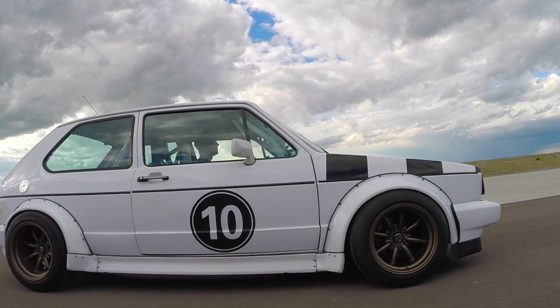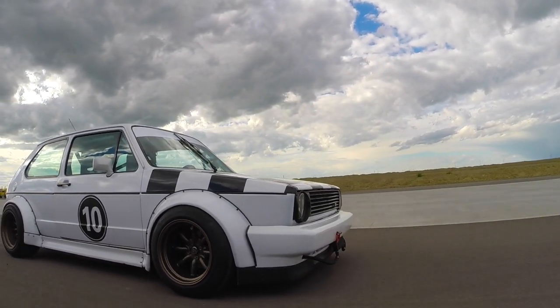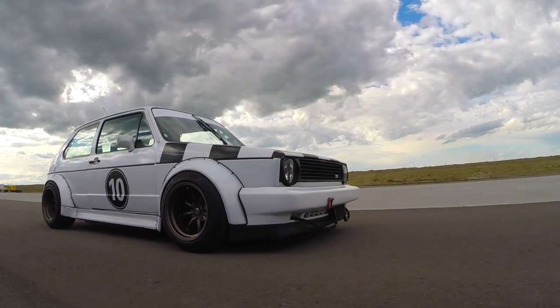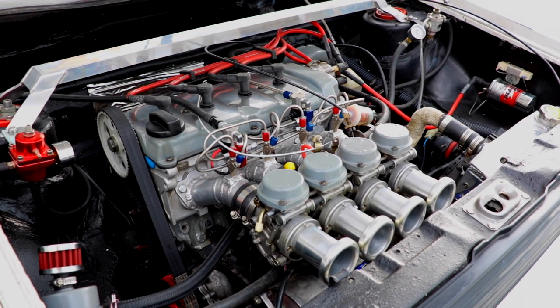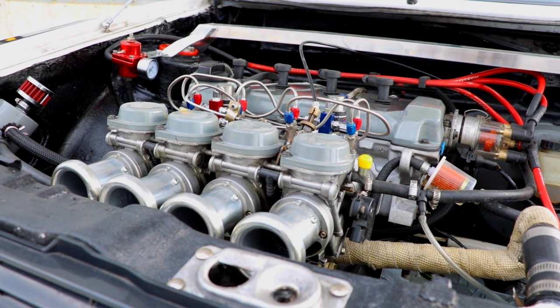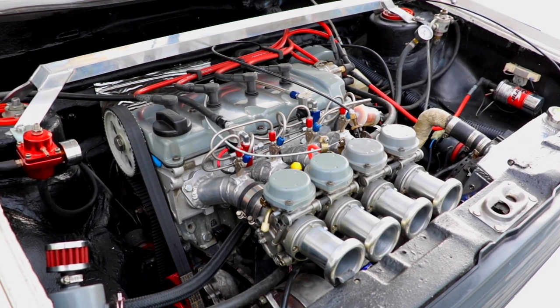This is Pascal Abel. This is my 1983 Volkswagen Rabbit GTI. Really fun car to drive. Handles great. Bought the car in 2005. I've had many motors in it, many styles in it. I've gone through a lot. I'm running right now an ABF clone, 2.1 liter, on Yamaha R1 bike carbs with 107 nitrous. Motor should push around 250 right now, plus the nitrous.